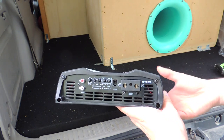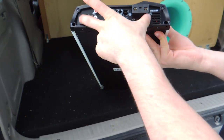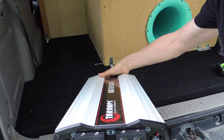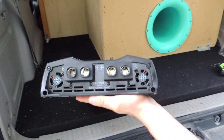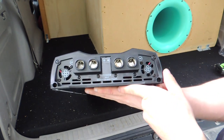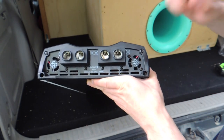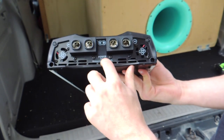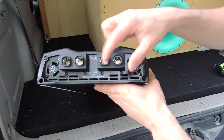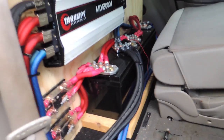For outputs, you can fit four-gauge wire in there pretty easily. We do have fans on either side — these things are quite noisy. It has at least four fans total. We also have dual power inputs, which are two-aught inputs. The amp says definitely do not use anything less than that, and I actually have dual inputs going into each of these.